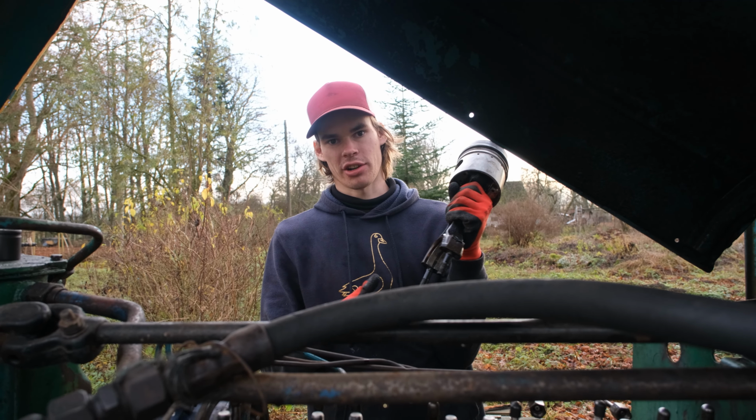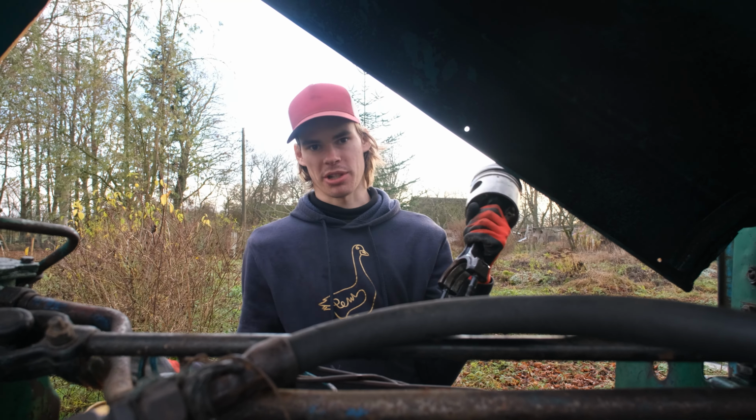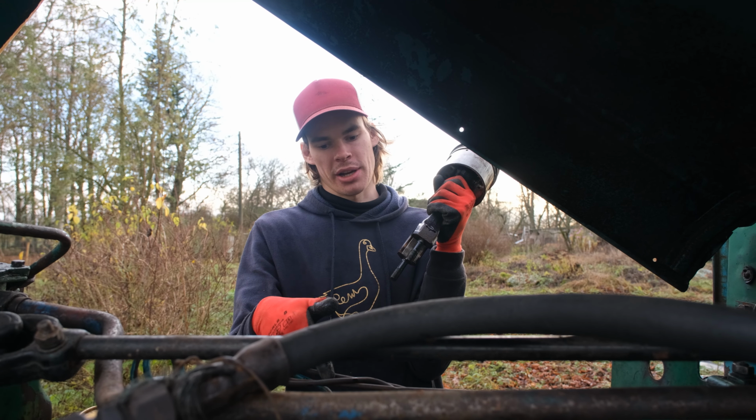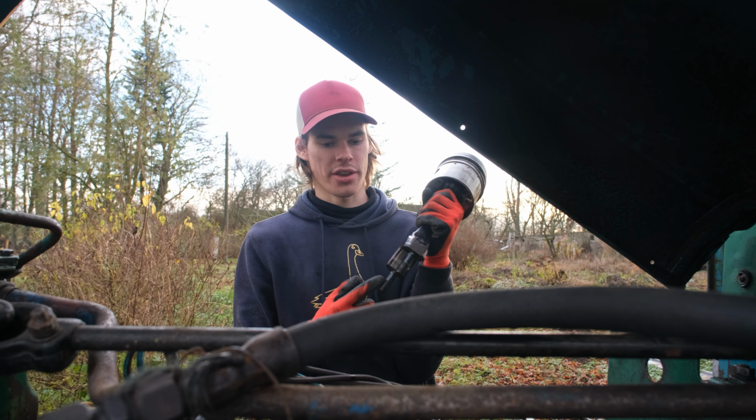I did call the tractor repair guy who is helping us, the technician. He's pretty much an expert, an older guy that knows everything about these tractors, been working on them all his life. And I asked him if I can put these rods into this one, because the shaft, the crankshaft, it's more worn than that one. You know, and there's the difference and there could be a gap.